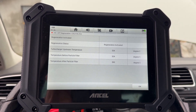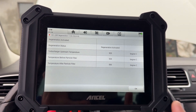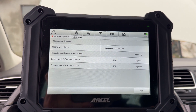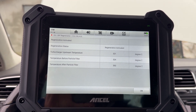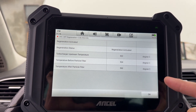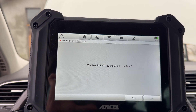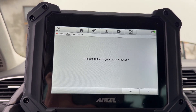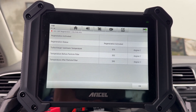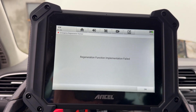It's been probably around 45 minutes now and it's starting to get close to 600 degrees after the DPF. Unfortunately what I don't like is that I don't see a graph or a progress bar — it just shows me the temperatures and that's it. If I want to go to the next menu and press OK, it's going to ask if I want to exit the regeneration function. It's not smoking anymore on the exhaust, so I'm just going to end it now and see what happens.